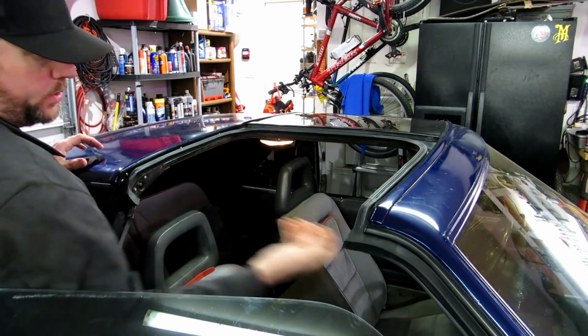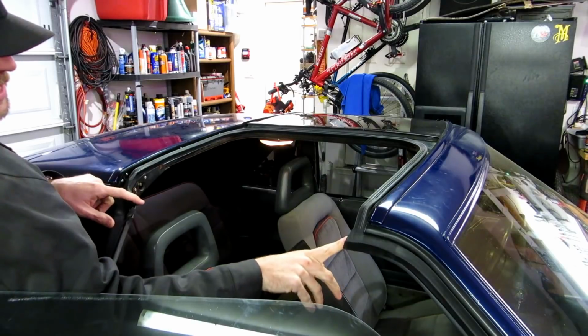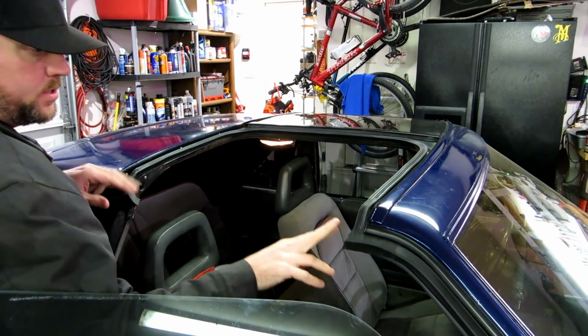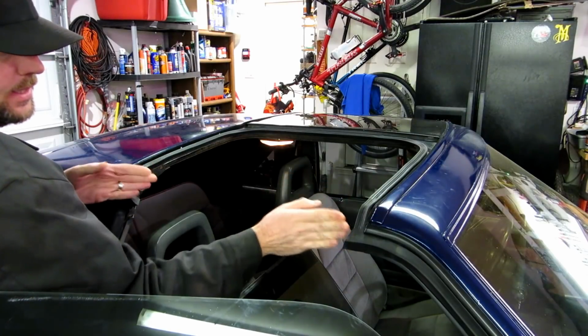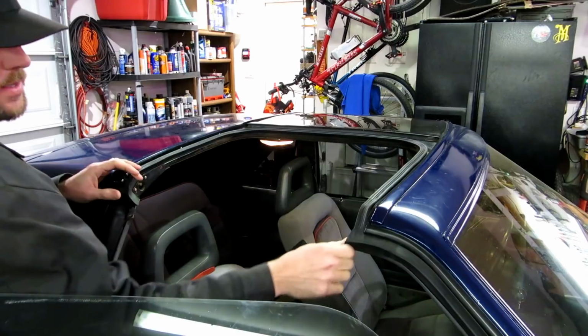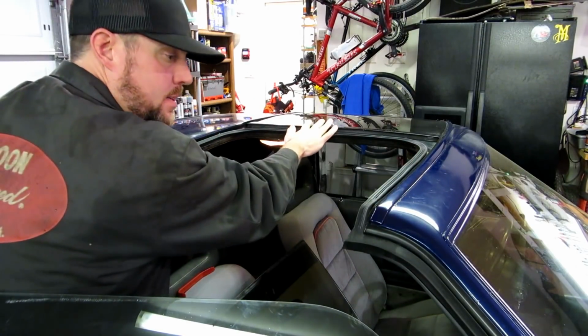Now there's another seal that goes across here that is made perfectly up against these angled pieces here, and that helps keep the water out. This is the part that's leaking the most and can cause the most leaks. So your T-top has to fit nicely into these, not squish into it this way or squish into it that way and cause these things to bow up. So I wanted to show you guys, so this place is in mock-up.